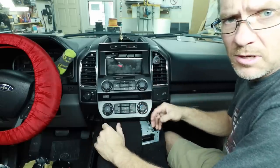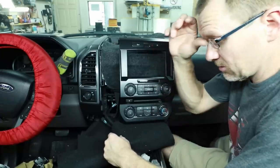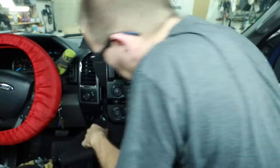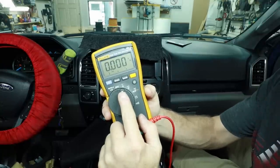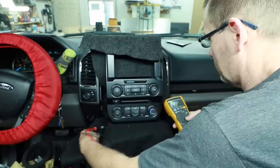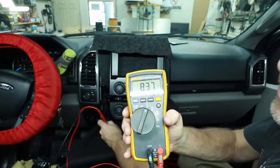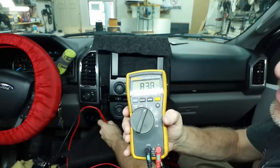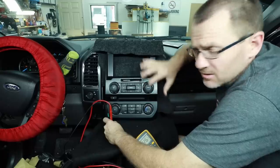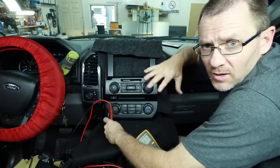We just need access to this side of the plug, but we also need to plug the unit back in because we need access to the volume controls. We've put in a CD with test tones — you can use a CD or your phone. We're going to need a 1,000 Hz and a 40 Hz zero dB test track. Turn your volume all the way up. Select AC voltage on the multimeter — that's the V with a squiggly line; dotted line is DC. Connect to the outputs of the radio. We can see we're getting eight and a half volts at 40 Hz max volume, so the low frequency is within our range of the amplifier.